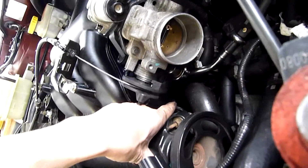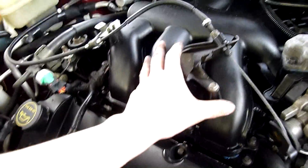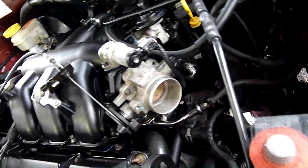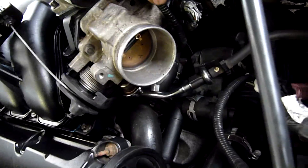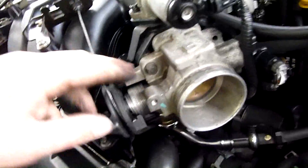The line goes down to the valley between the cylinders - I'm guessing it's a crankcase breather. I'm destined to pull all this off. I've already got the set of O-rings for the intake plenum on order - they're waiting at the auto parts store. There's only two bolts holding the throttle body on, which is odd. That one hasn't been removed though - it's still got a cap on it, like a plastic security cap stuck over the end of the thread. I'd expect there to be four bolts, considering there are four holes.